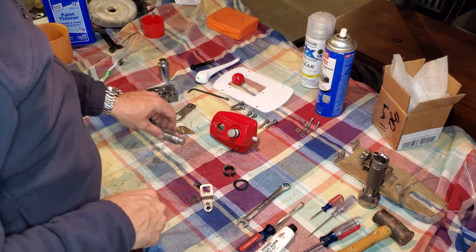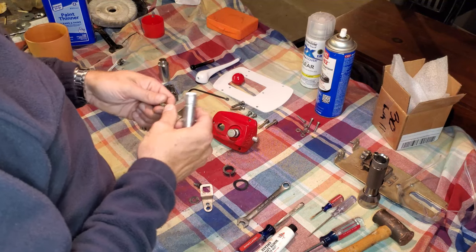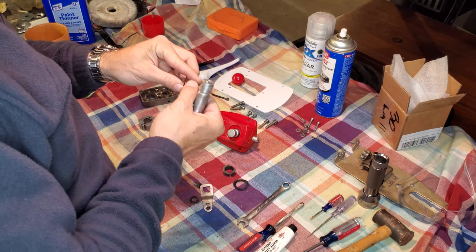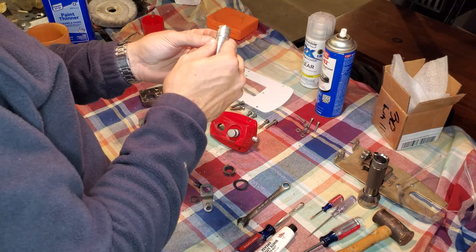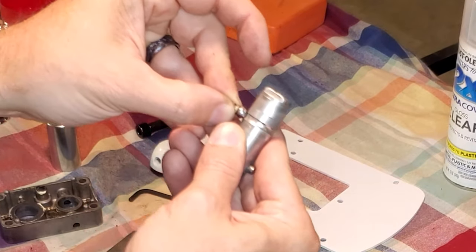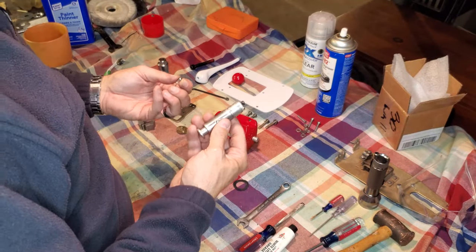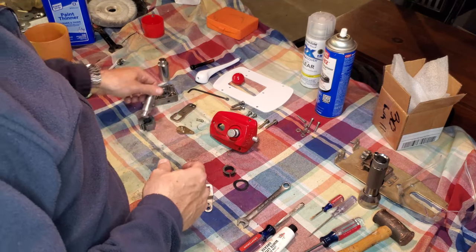The purpose behind a detent ball is to apply pressure in a specific spot on each one of these cam assemblies, basically to keep it from spinning around in its seat. You'll get a better look at that when I have the whole thing assembled. The shifter detent spring and ball assembly are very, very easy to work with. We'll cover that in a moment.